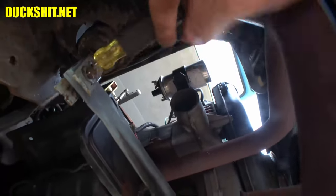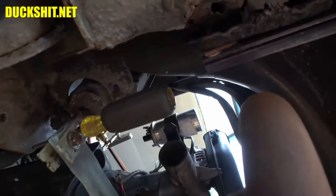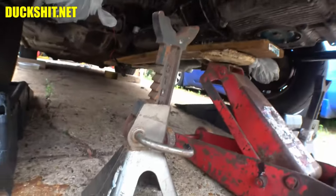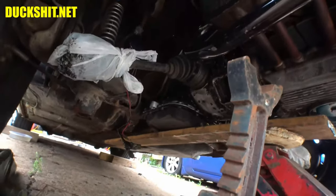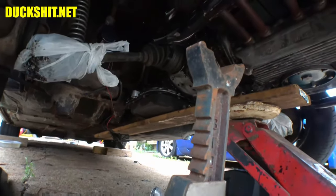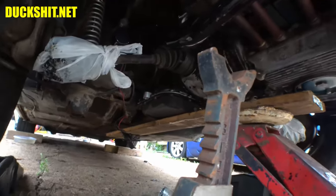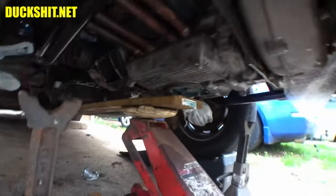There's our first bolts — or pins, if you will — that are put in here. This is a mustache bar, so I just simply jacked it up, put a Phillips head screwdriver in there just to find the hole and lever it into place, then slip the bolt in. It's the same on both sides, so the jack stands underneath can actually go away — they don't need to be there anymore. The engine is essentially hung. I need to get up front and mount the bolts that go to the torsion tube — there are four up front and I need at least one in to make sure we're in a good spot.